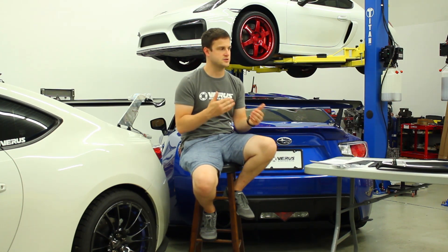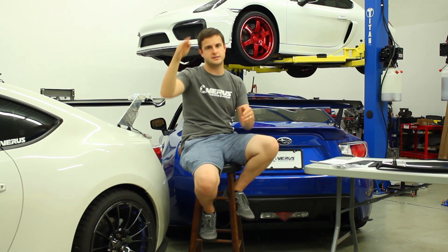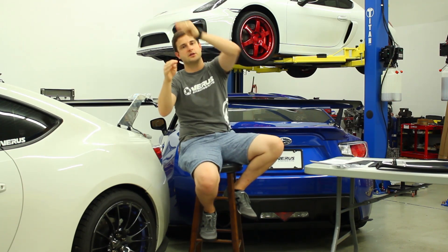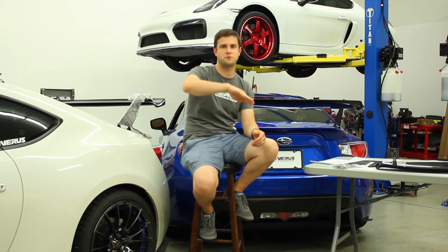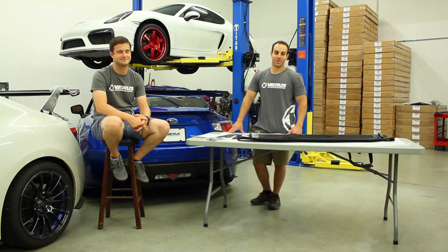It's very cambered, but because of how it's designed, when it stalls it stalls as a trailing edge stall. There are two types of stalls wings can have: trailing edge and leading edge. A leading edge stall is fairly common — downforce peaks and then drops off significantly, while drag increases. A trailing edge stall is considered very soft — downforce peaks, levels off for a few degrees angle of attack, and then slowly decreases. The benefit is you don't have to worry about dramatic losses in rear downforce at the track, which makes the car inherently safer.